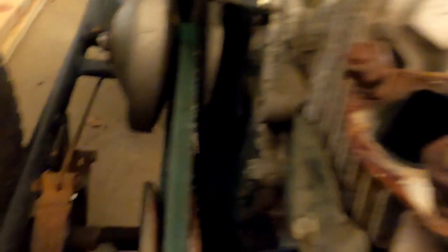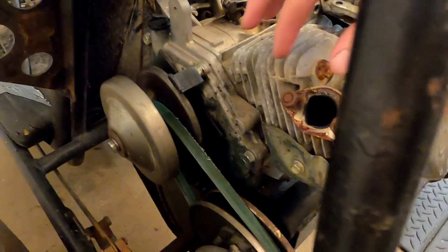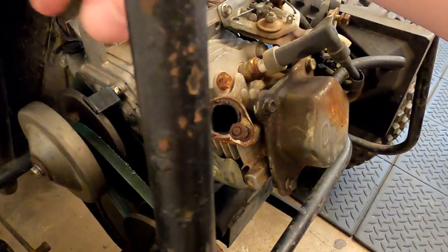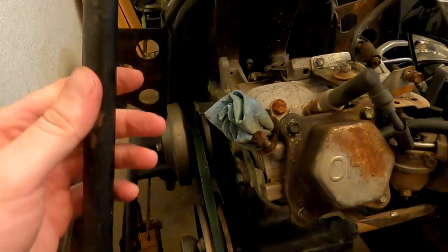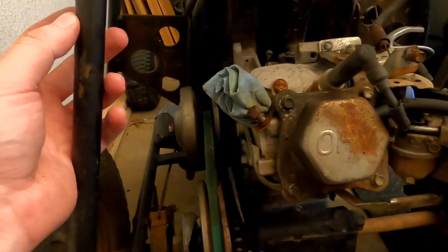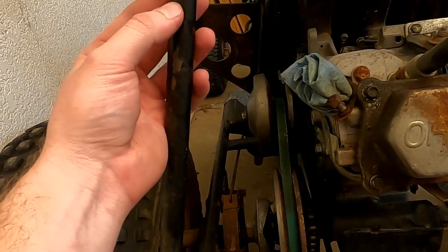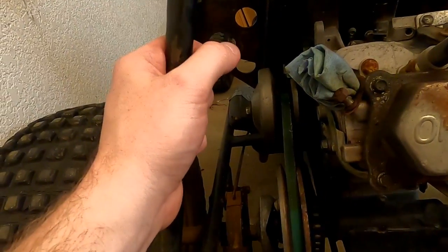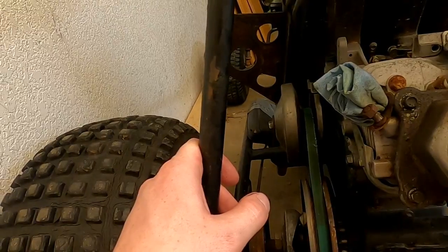I want it to kind of aim up a little bit. Actually we kind of want it to lean back a little bit because the port is angled about like this. So we're going to try to angle it back a little bit towards the camera here. It's almost a 45 degree angle out that way, but we want it to lean back so it will flow out that port better. And that's not the only reason — if we angle it back, I can weld a small support bracket, and we can also bolt it to the chassis. Because we don't want the weight of this muffler just dangling off the flange.